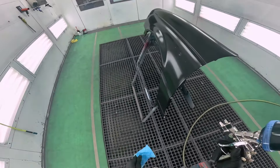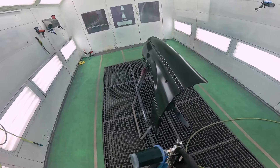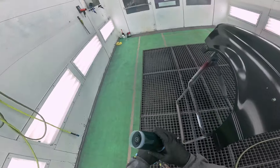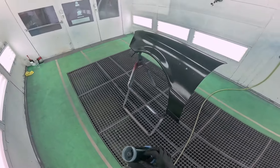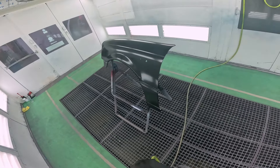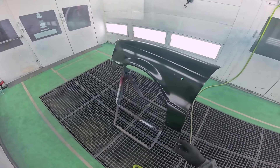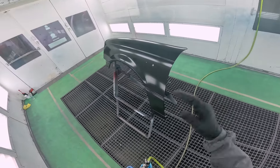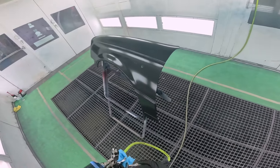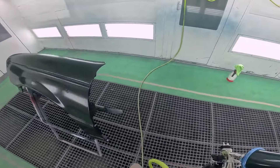Because it's waterborne, I'm going to spray this decently wet. There's one thing I want you to know about waterborne black — because of the high carbon content, I do not do a wet-on-wet application. If you do that, it could cause what's called bronzing and it'll basically turn this thing into looking like mud. We're going to dry each coat individually. I only need two coats — that'll be good and covered.